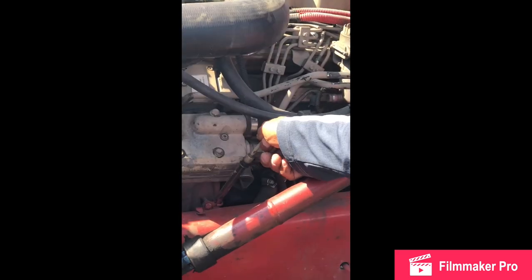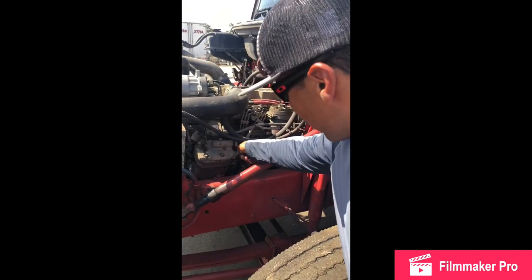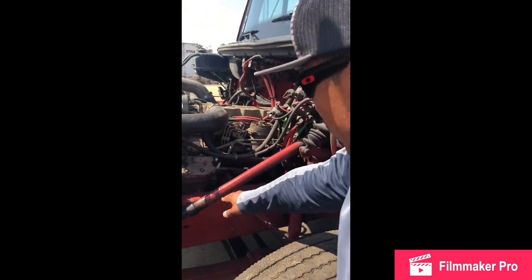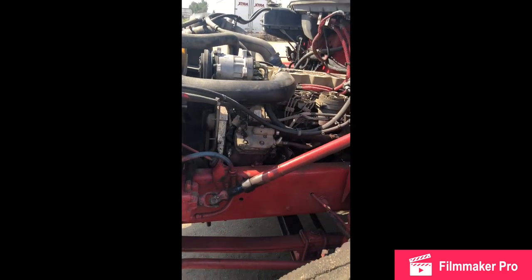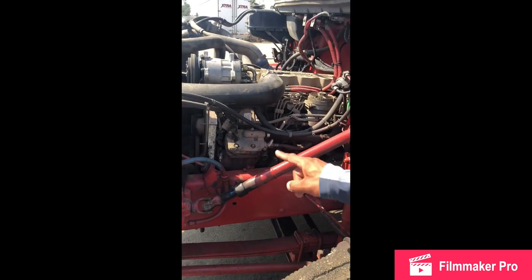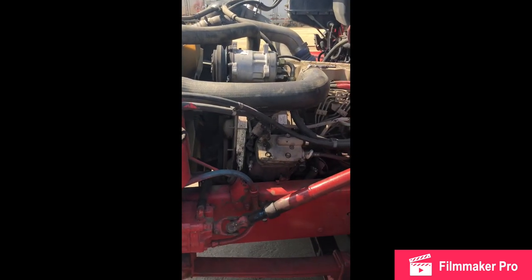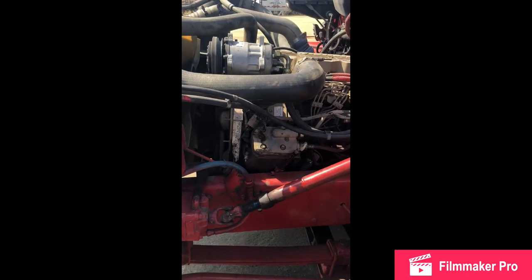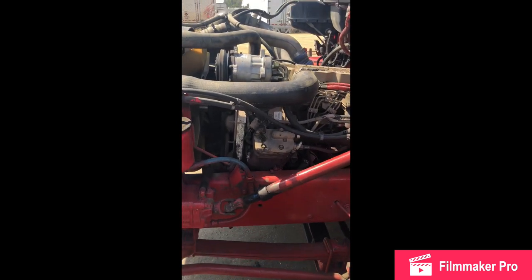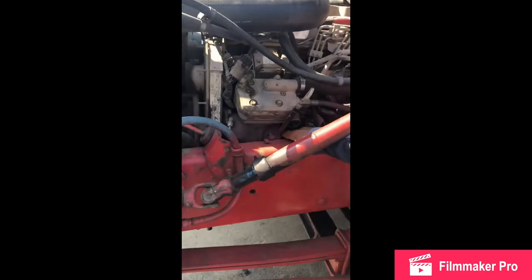My AC pump belt, water pump belt, alternator belt, and radiator fan belt: no cracks, no breaks, not too loose, not too tight, no more than three-fourths of an inch of play, mounted and secure. My oil dipstick: no cracks, no breaks, easy in, easy out, oil level is full — checked this morning, mounted and secure. My air compressor and governor: no cracks, no breaks, no leaks, gear driven, securely mounted with nuts and bolts, mounted and secure.